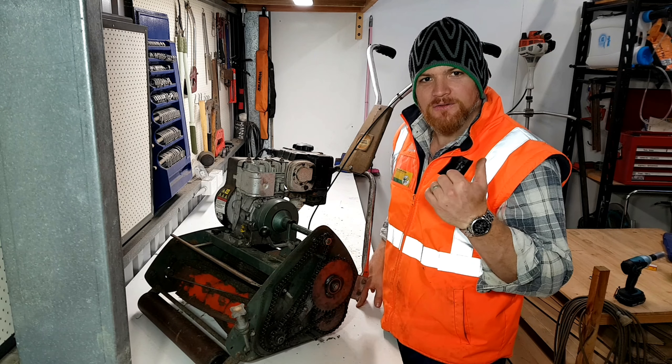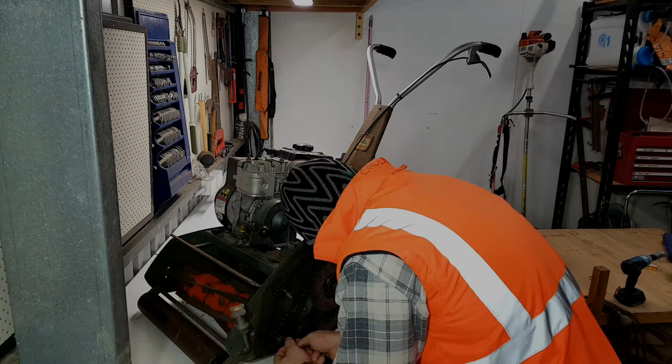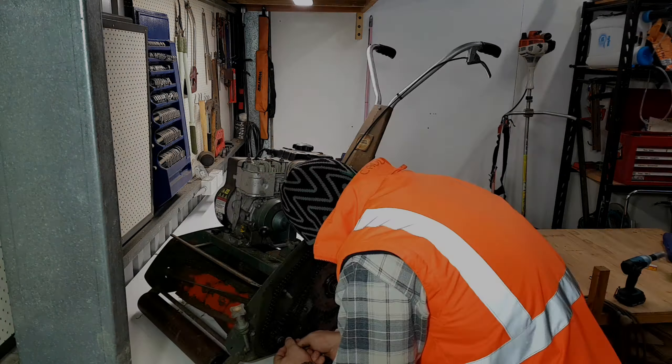The first thing I like to do is actually take the chains off and let them soak while I'm doing the rest of the service, for about half an hour or so. Here we go — we're inside the chain cover. This chain here provides drive to everything. When we engage our clutch here, it starts spinning this shaft on top, which then turns the top chain. It's not until we pull the clutch that the drive chain down here is engaged, because there's a cork inside this one that gets mashed together, which then provides drive to our drums. I'm gonna pull these chains off and soak them in fuel for half an hour while I service the rest of the engine.